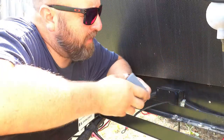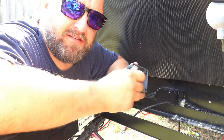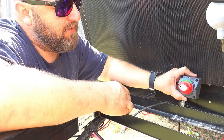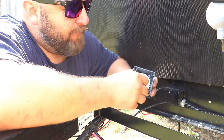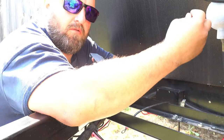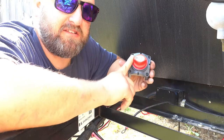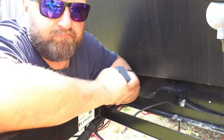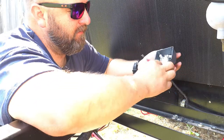After you get your holes drilled, the disconnect switch has plates that usually pop out — these slide. Depending on how you want to mount it, if you want your wires to come out the side, take the side plate out. I'm going to come out the bottom so I took that out. Take your nuts and lock washers off, and put it in disconnect mode so we don't spark if anything is drawing power — just a safety precaution. Let's go ahead and connect our two wires.